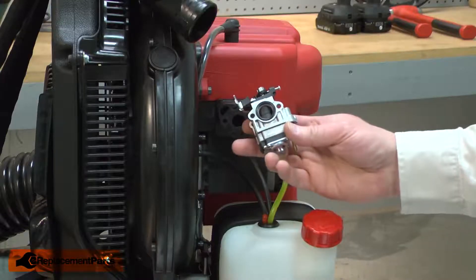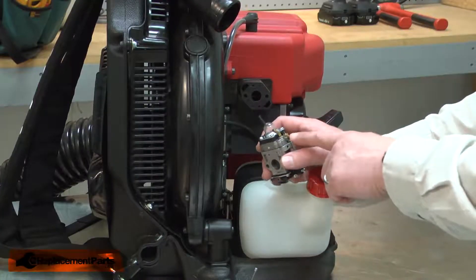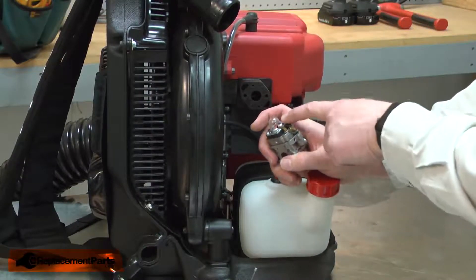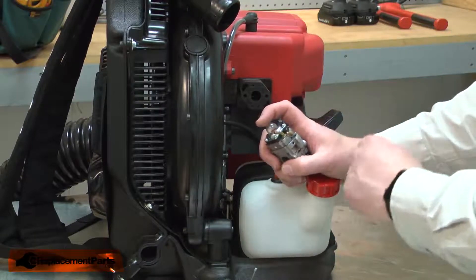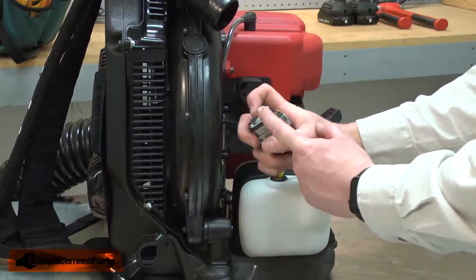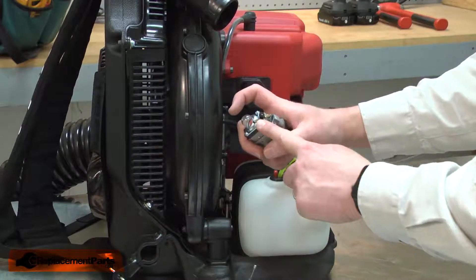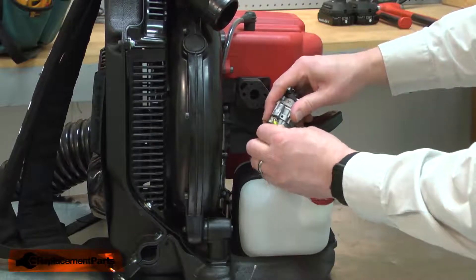Now I can reinstall the carburetor. As I install the carburetor, I'll need to identify which of the nipples is the incoming and which is the purge side. To do that, I'll place my finger over each of them and prime the carburetor. With this nipple, as I prime the carburetor, it's stiff and no air is passing through. I'll plug the other side. Now when I prime, you'll see the primer bulb doesn't want to return and a vacuum is formed at my finger. This is the incoming line. I'll connect the incoming hose to the incoming nipple and then the purge line.